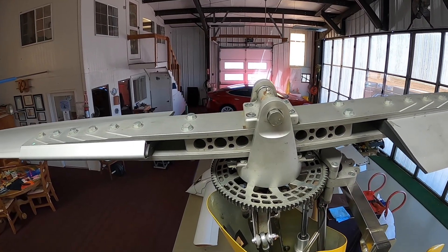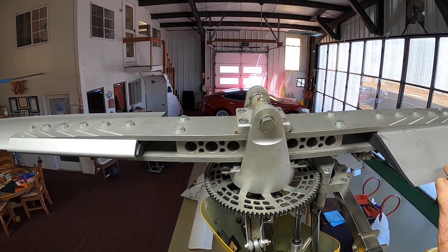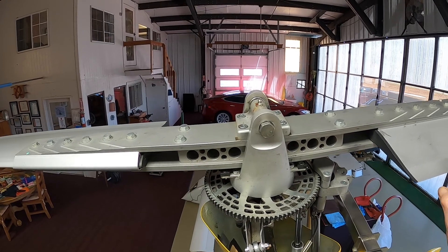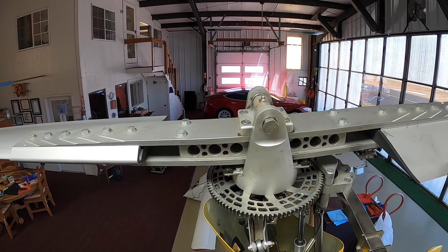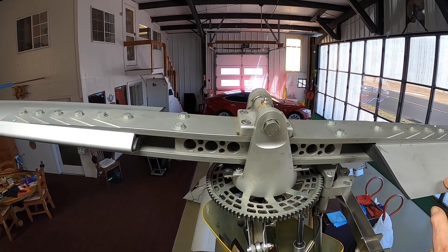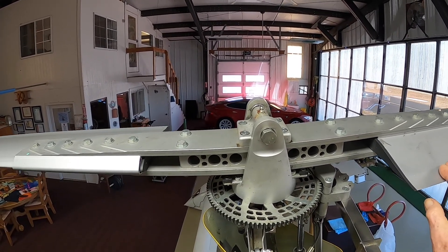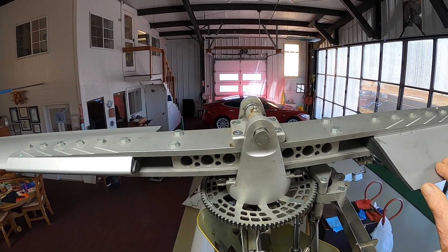The only time you can get excessive flapping is when you're pre-spinning the rotor blades on your initial takeoff. If you don't pre-rotate them fast enough before you add throttle to start your forward movement down the runway, you have to do this very gently and let the blades spin up from the point of maximum pre-rotation to where you release the mechanical pre-rotator. Then you continue the pre-rotation as you're on the takeoff run.